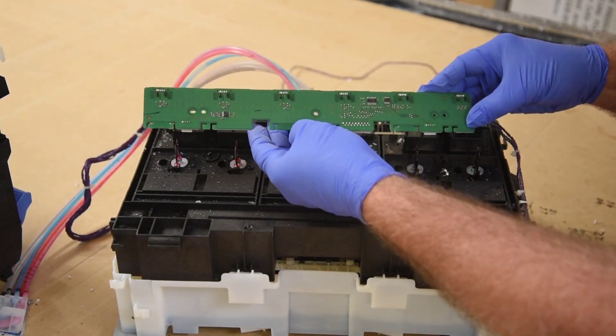I'll pop these gears off the end and get them out of the way. Looks like it's set up to move one of the cams when the motor is turning in one direction and move the other cam when the motor reverses direction. Seems the cams are held in place by these three plastic bars, each with one screw attaching it. It is nice that so much of this thing is put together with screws. The lower cam just about falls out, so that's good. Just a plastic clip on the gear and it pulls right off, and the cam comes right out - very easy to remove. But I don't think that is the one that is causing the problem. The gear comes right off the top cam, but it's still held in place pretty good. Looks like the arms riding on it are on the top and bottom of the cam, so it just can't pull out. Every time I move this cam, I end up with more ink coming out.